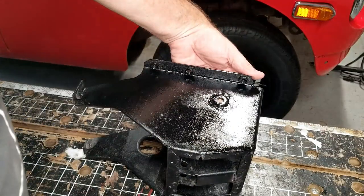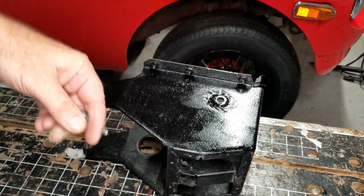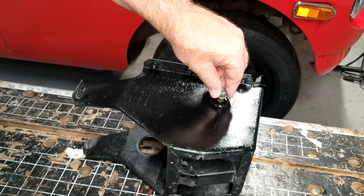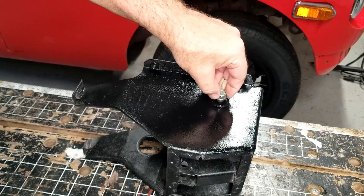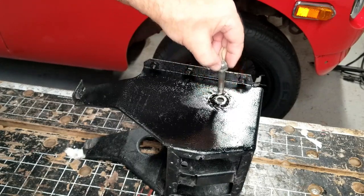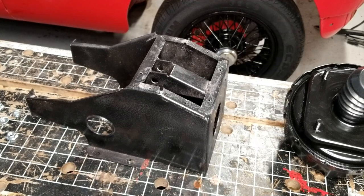All nicely welded - you can see I've got the washer in there. I've thrown some paint on it to keep it from rusting, and this bolt now fits very nicely in there. We won't have any problem with punching the clutch constantly creating any kind of racket. That's a much better fit. It's all about inspecting and finding little problems before they become big problems.